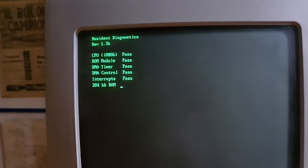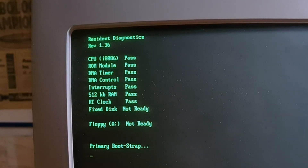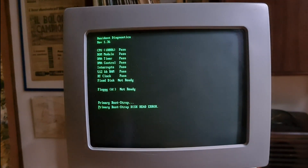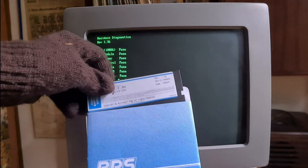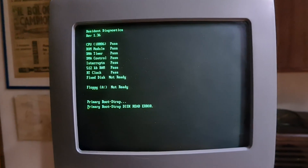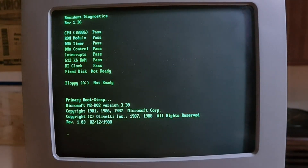Let's turn on the PC and see what happens. The PC is starting and checking its internal components. You can see that the CPU is an 8086 — the first 16-bit processor running at 8 MHz. It has a little more than 500K of RAM. The operating system is MS-DOS. It's not on the hard disk, and the PC complained because it didn't find it. So I need to use the floppy disk with the operating system. These are the Olivetti floppy disks with MS-DOS — the operating system of those times. I insert the floppy disk in the drive and close the lever. Now the PC is happy and ready to go.